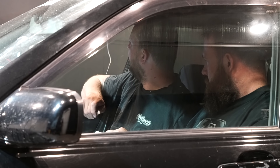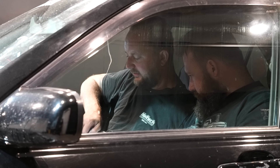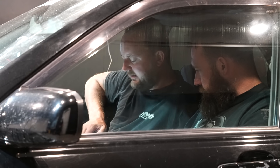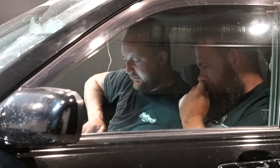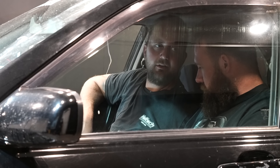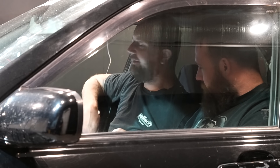The power is rolling off by about seven grand, so we'll limit it there. Now we look at the mixtures, short-term and long-term trims — short-term is adding two percent down low and pulling half a percent up high. It's about as close as you're going to get — that effort in the beginning is reflected in the long terms as well. So now I'm going to give the long terms a helping hand and linearize them in because they're just spots I haven't got to yet.